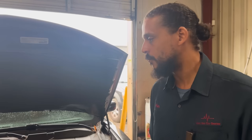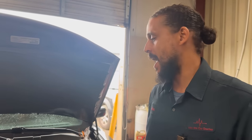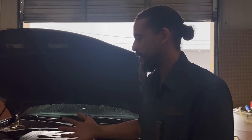This engine is pretty much shot. I would have to go through it and do a mild rebuild — checking main bearing caps, connecting rod bearing caps, which I'm pretty sure are scarred up, changing the oil pump, changing the oil cooler. At this point, for simplicity and to get their car back faster, they might as well put an engine in it. As you saw on the test drive, it's going into limp mode because the oil pressure is not within spec. Even if I put an oil filter housing on it, I've seen worse oil cooler issues where pressure was still in spec — so an oil pressure gauge on this engine will probably yield the same result.